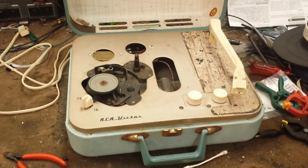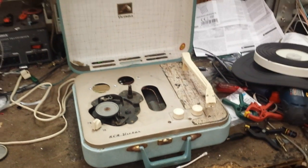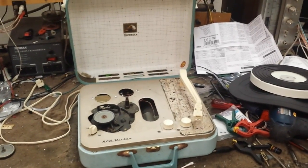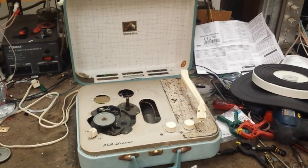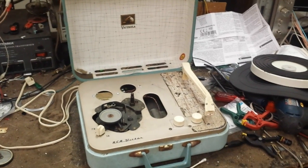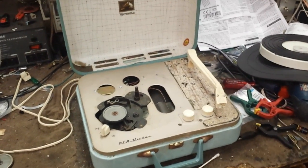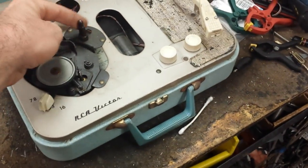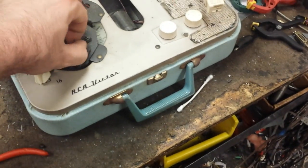It's a famous one-tube wonder. These usually have a very high output cartridge and a single 25L6 that's in series with the motor. They've got a 90 volt motor and a 25L6 to make it 110 or 115 volts. And it's a four-speed changer. It's got a new idler on it. I cleaned and lubed this bearing, which freezes, and lubed the motor.